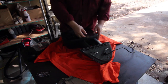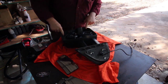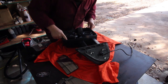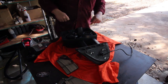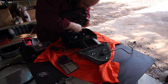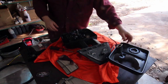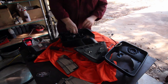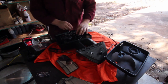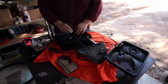Now we have to remove the bottom piece — it's going to be kind of the same process. It just pops right out, and then we're going to need a screwdriver to remove these guys. There are four screws in here so we're going to pull them out. Having unscrewed that, this should come off and we can unplug the backup lights. Now we have access to this whole back area, including where this LED is down here, and what we're going to do is unplug that little blue LED.